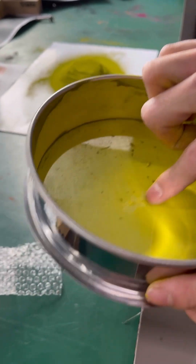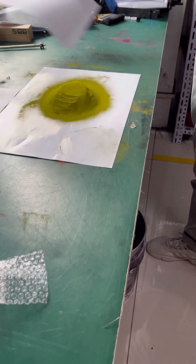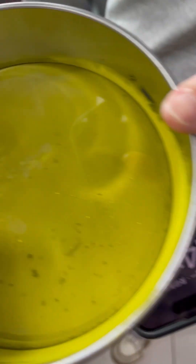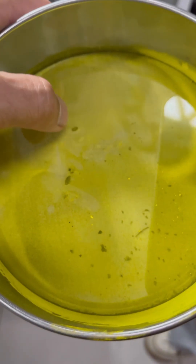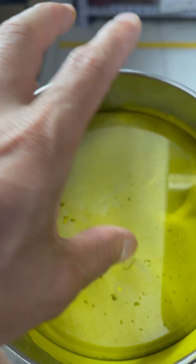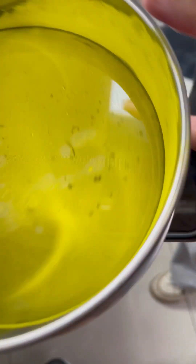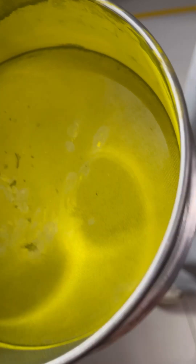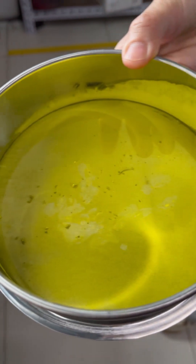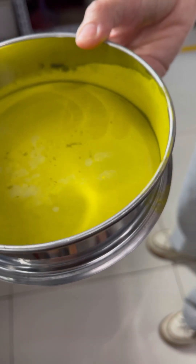It's done. Let's look here — these are not toner buildup. As you can see, these are foreign objects; they are made of sponge, actually. If you press them they should break down, but these are spongy. These are particles that came out from the developer unit itself, and this is causing the developer to not be evenly spread on the roller.